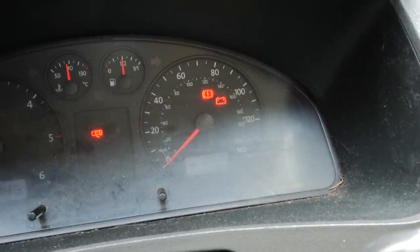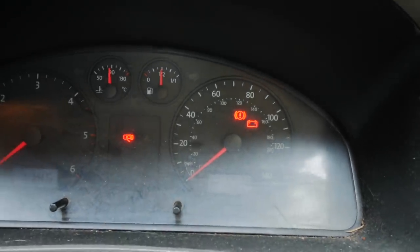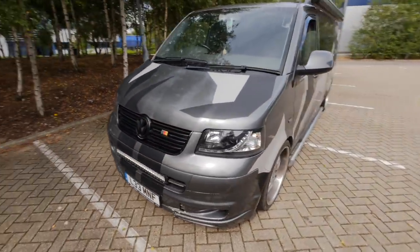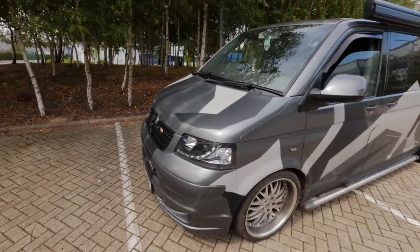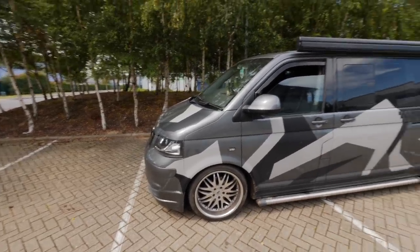Let's go through mechanically what's happened in the last three years, because obviously this is a Volkswagen Transporter and everybody knows they're a money pit. We've done 238,000 miles now. So at this mileage we can expect an issue or two. The first major problem I had was the gearbox seized up - it started making a whining noise in fifth and then one day after a trip around Scotland, I was just down the road and everything locked up. I fitted a reconditioned gearbox, changed the clutch and the flywheel, and one of the drive shafts was worn as well because these are known for it, so I changed both of those plus some mounts.